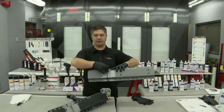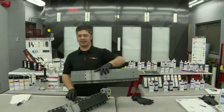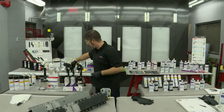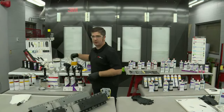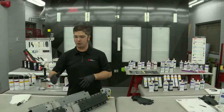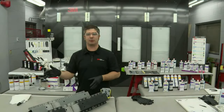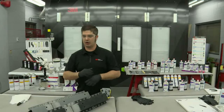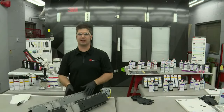And they say, well, now we've definitely got protection here, right? And that's not what the OEMs want to be done. In fact, Nissan calls this out specifically in their procedures, and they say, in order to restore corrosion protection, if you can't access it and get at it with ease and apply appropriately top coated paints or materials, only use a cavity wax, right?